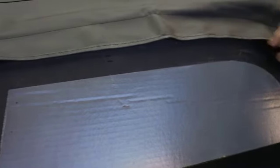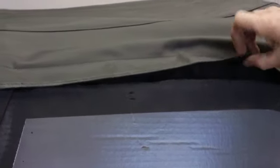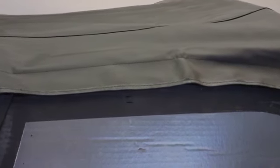It is just that, a flap. The side curtain must go beneath it so that it has an umbrella effect. And it works pretty well sitting out in the rain. However, while driving down the road at speed, you can see by touching it that it actually flaps up and down. And when it does lift up, and you lift it a little higher, you'll see that what's behind there is nothing but another flap. Since the side curtain has got to be held just shy of going too far up in there so the door will be able to open, it is only an umbrella.